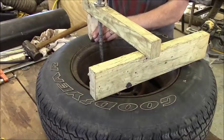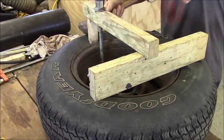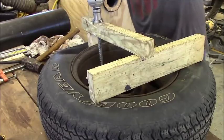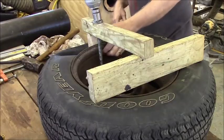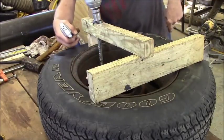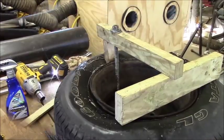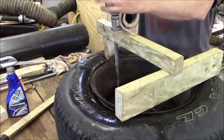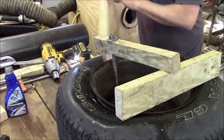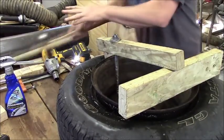Let's see if my assessment is correct. Now it's off. The bump right here - it's below that. But as you can see it's being real tight because that wire bead is still up tight and it hasn't got any slack to move. At the last push I got the bead to stay down a little bit, so I'm betting this one takes it off. There it goes. See, they're much tighter on that side - that's why I just got to push them a little more.